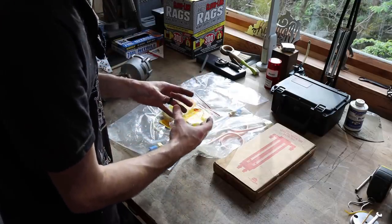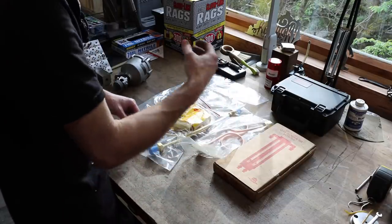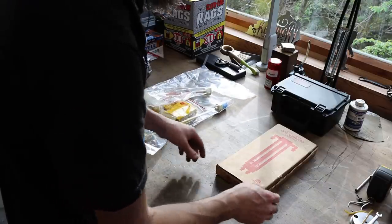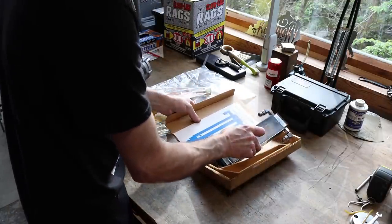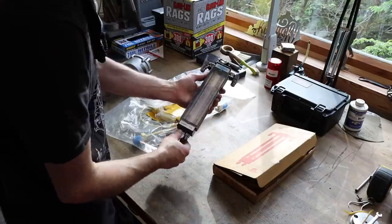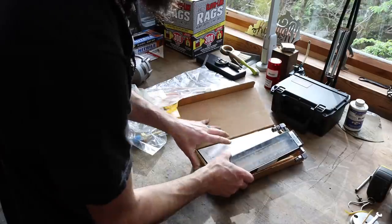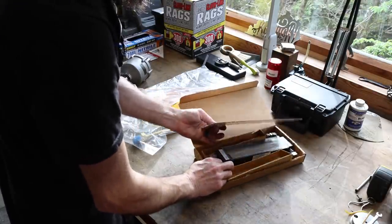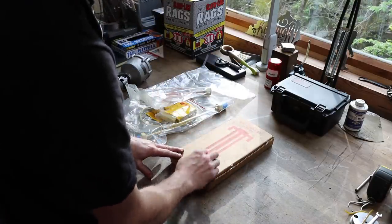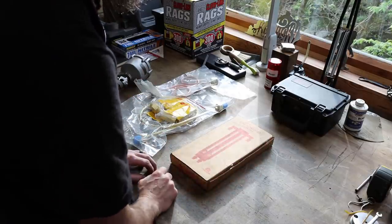In an acetylene bottle is a matrix in acetone where the acetylene fuel is dissolved in — I believe that's how it works. If you pull too much too fast, it doesn't come out of the acetone and you're at risk of pulling it into your lines. So I'm going to have to look into getting another acetylene tank before I try to run that thing. Dave also sent me a flow meter — this is a used one, they're quite expensive new. It's both an oxygen and fuel flow meter so you can dial in the proper flow rates to get good performance out of your torch. We'll have to make a holder for this to go on our torch rig. All I need to do is pick up some powders and look into getting another tank. Thank you, Dave. Thank you, Eutectic Castolin. If you guys have any questions, Dave is the guy to talk to — he will definitely enlighten you on the world of spray welding.